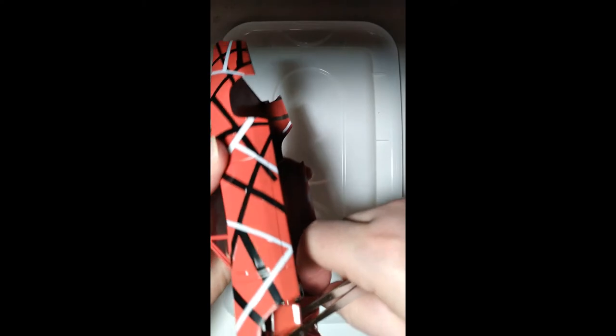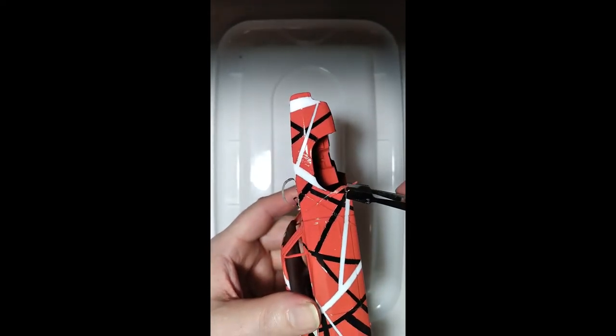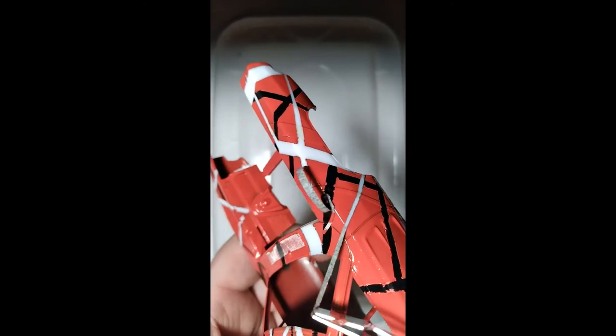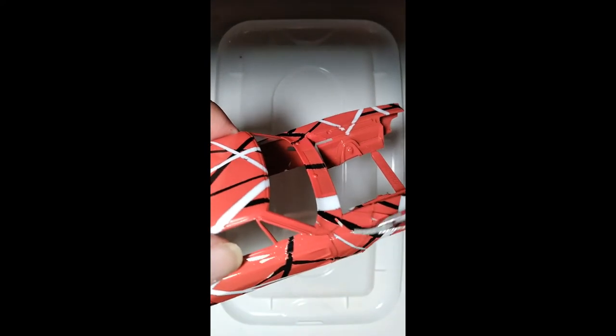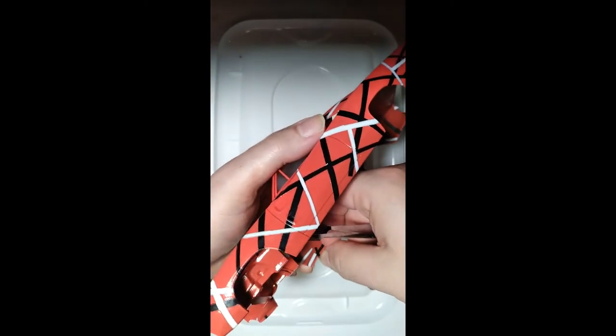I've talked to different painters about this, and some want to pull the tape right before the paint actually dries, because pull off is less prominent in those situations to them. But I've also heard painters say they want the paint at least, if not 100% cured, let's say 90% cured, to the point where they experience less pull off when demasking. But when it comes to this type of stuff, it's random. It comes down to temperature. It comes down to the quality of the materials you're working with. All those factors are going to vary depending on what type of paint you're using and what type of tape you're using. Your materials and your tape do matter.